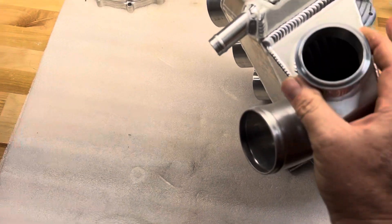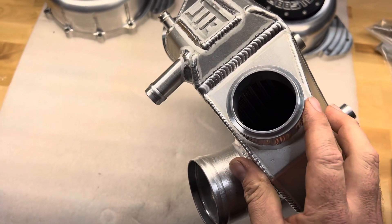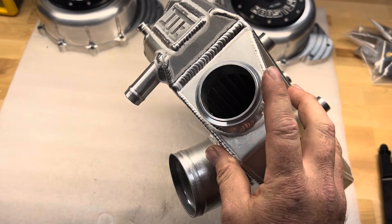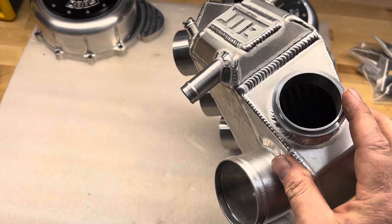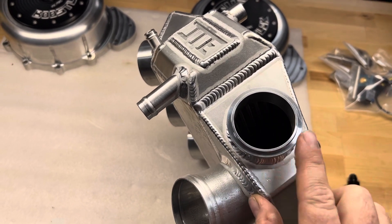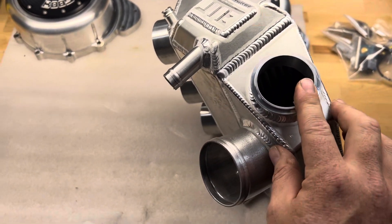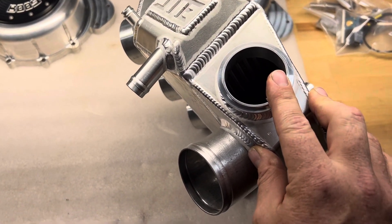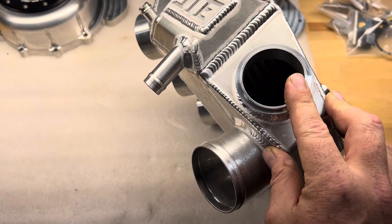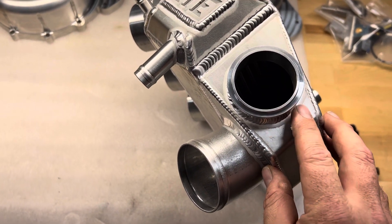This one is custom — it has a 50-millimeter blow-off valve port on the backside of the tank. Now, this doesn't fit with the factory oil lines. Without this blow-off valve, your oil pipes kind of run down and go right past this area. In this case, this customer has an aftermarket tank and a dash-10 line to an oil cooler, so it doesn't make any difference. This is how I do it on our shop car as well.